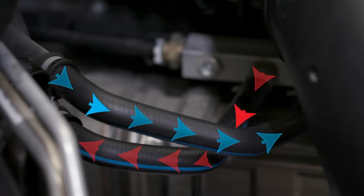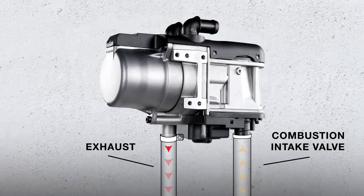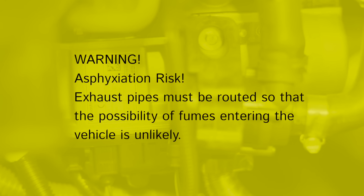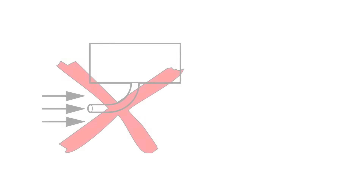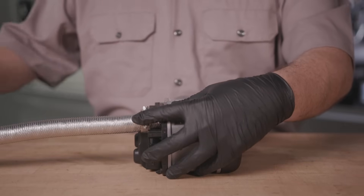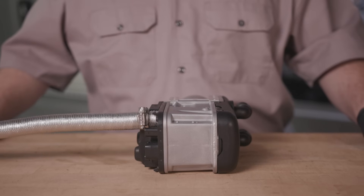Inspect the engine or consult the truck's owner manual. Once the heater is mounted, you're ready to attach the combustion and exhaust tubes to the heater. Route the combustion tube and exhaust pipe with a downward slope away from the heater and position so the air intake isn't drawing from the exhaust or from inside the truck where people are present. If you can't get the lines to fall away, drill a four millimeter drain hole at the lowest point to allow condensation to drain. Avoid pointing the outlet toward the direction of travel — this helps prevent clogging from dirt, snow, or other debris and avoids causing a fault. Attach the combustion air tube to the black plastic port at the bottom of the heater using the provided clamp, making sure all bends are at least three inches away from the heater connection point. Next, clamp the exhaust tube to the metal port and route so it's positioned at least two inches away from any heat sensitive materials.